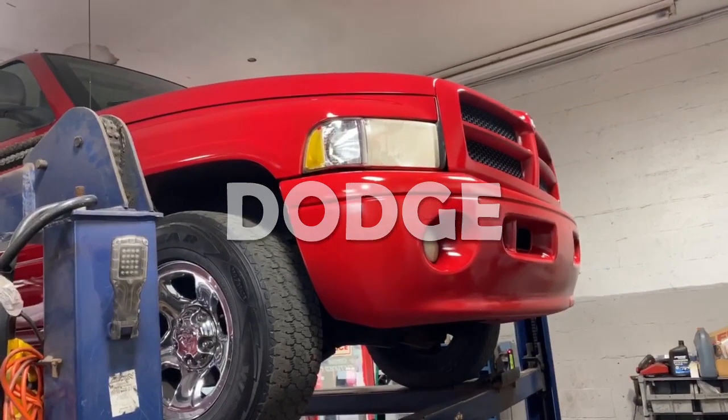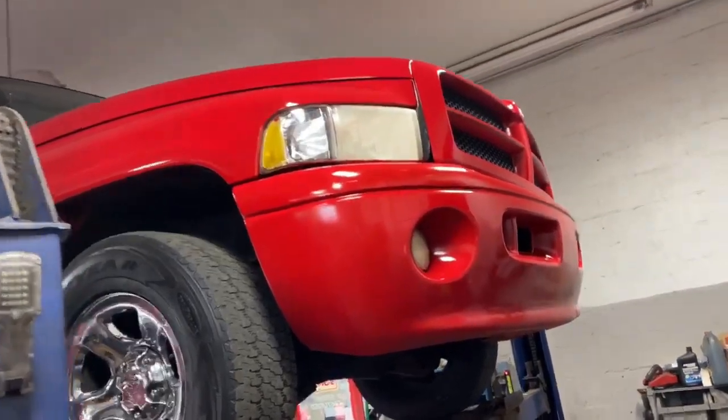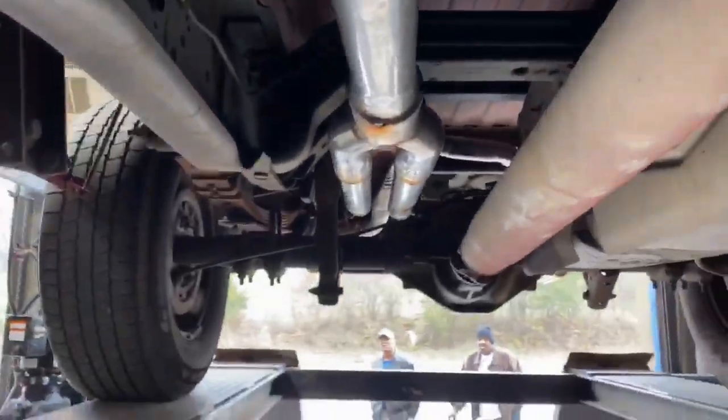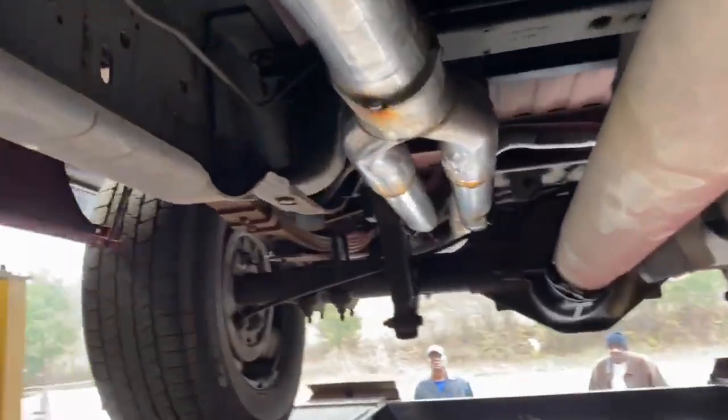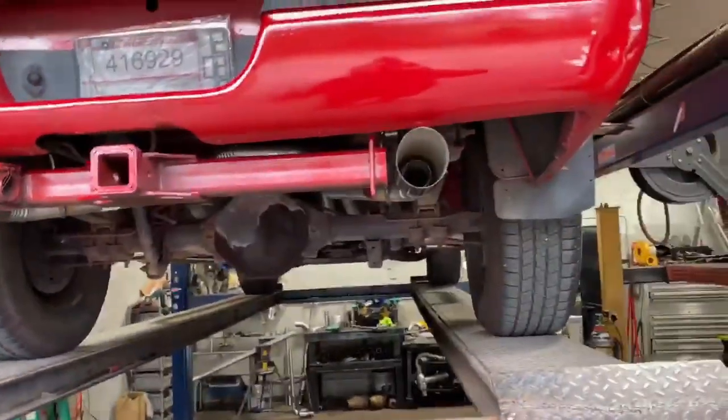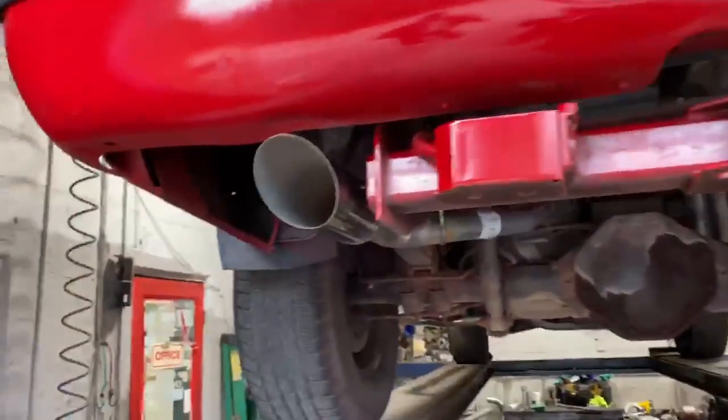2000 Dodge Ram 1500 5.9 liter. What we've done on it for you guys today is, it still has all the stock converters, one right there, one big one. Then we widened it out and straight piped it with 3-inch to 2 1/4 tailpipes. And then 3.5-inch tips, one here, one here. This is how you get them dualed out, boys and girls.